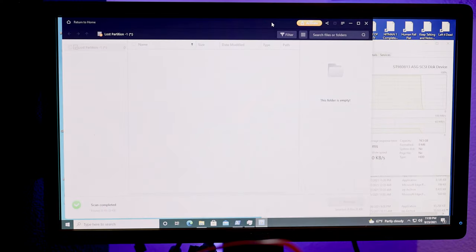To prove these methods actually work, I took a drive I had wiped that previously had data on it and plugged it into a system. It didn't show up with any multiple partitions at all in Windows, so the super easy way of getting data won't get anything. I then tried using a few drive data recovery tools that read every sector on the drive and try to match it with a potential file type — none of them showed any data on the drive. A single drive wipe is more than plenty for almost all drive wiping today. If you have major threats that might use extreme tools, I'd always use physical destruction as it is the hardest to recover data from. NIST, the agency that originally recommended the three-wipe or seven-wipe methods, has since said a single wipe is now fine, and I have yet to see any way that a modern drive has had data recovered after a single wipe. Thanks for watching — let me know if you have any thoughts or questions in the comments.